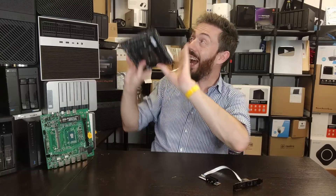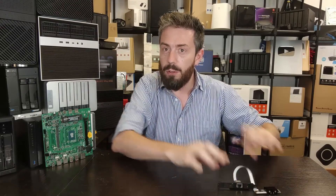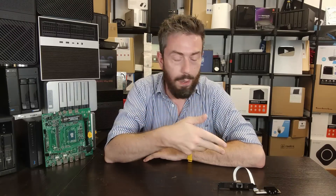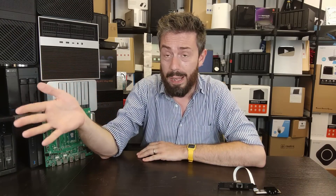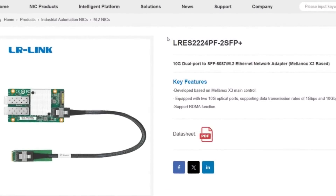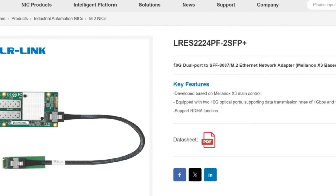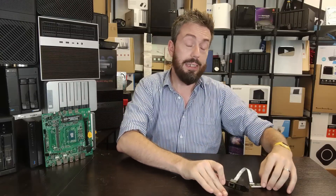If you're running a DIY rig and you happen to have one of the more modern PCIe mini-ITX mobos, like this one — this has got three M.2 NVMe slots on the front and back — that means there's a huge amount of potential. Some brands are going further: Linkreal, a brand we talked about in a recent video, has added not only an M.2 to 10GbE connection, but a dual 10GbE to M.2 adapter — that's 20 gigabits per second of network connectivity via a single M.2 interface.